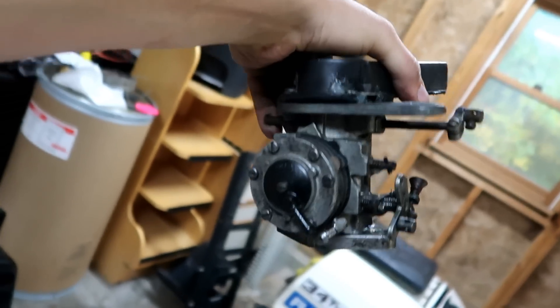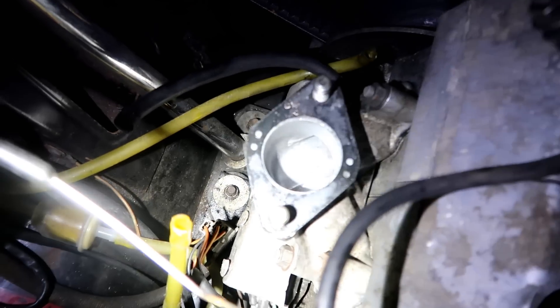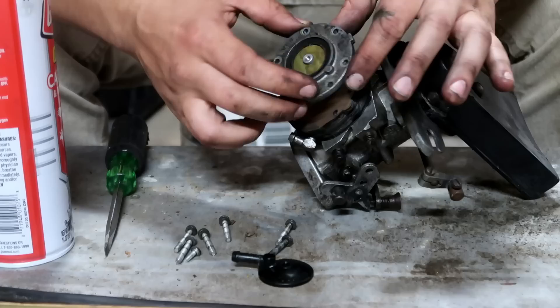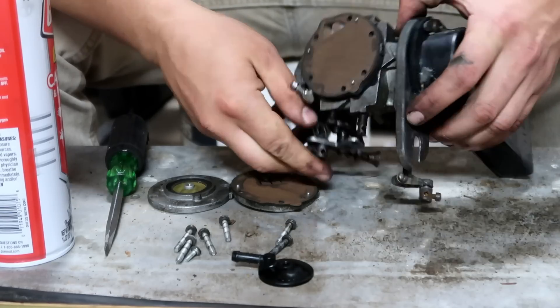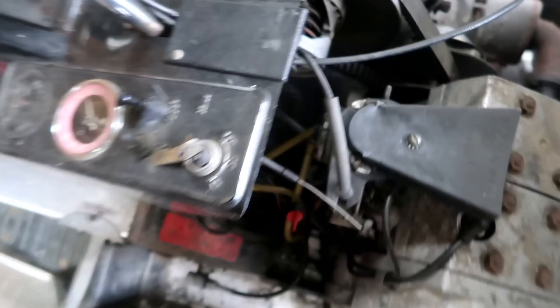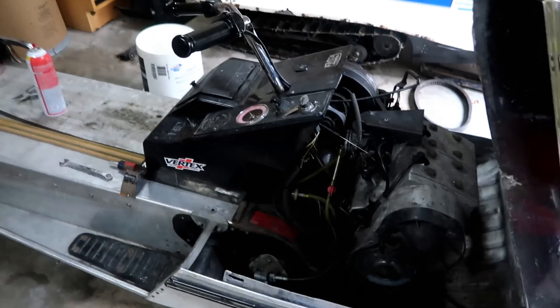Behold, the Tillotson carburetor. Exterior looks good, but that doesn't really say anything. I don't see any funny business going on down there — we might be in luck, this thing might actually be clean. Cracking it open. Pretty much what goes on here is just a sandwich. Everything looks clean so far, no rips, looks pretty clean in there as well, everything works slick. Choke works fine. Everything looks clean, man — I'd drink out of this cup. Looks like somebody shut the gas off and ran it out so none of the bad stuff would be sitting in the carburetor. Good thing to do.